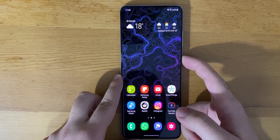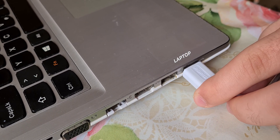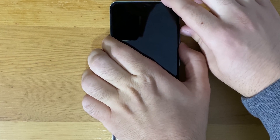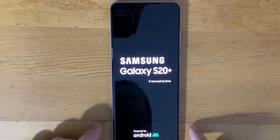Now that the update file is ready, you need to go to recovery mode. Connect your phone to a USB cable connected to your PC, or you can use the AKG earphones that came in the box. Then press Volume Up plus the Power button plus the Bixby button if you have one, and wait — it will boot into recovery mode.